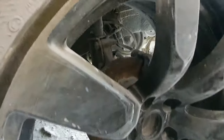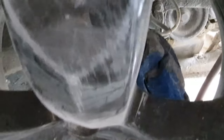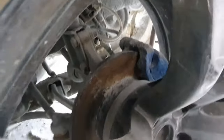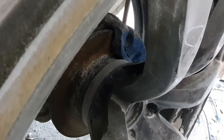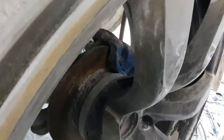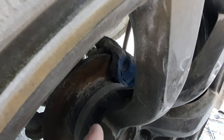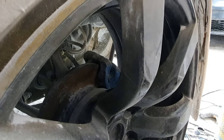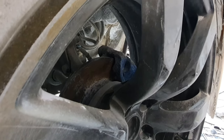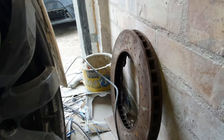So I've got the original 1.4 tiny little crappy brakes in there with the caliper. I'm going to have to do some work on that caliper to make sure the clearances are going to be fine for the new ones. Basically the disc is going to fit in that section and then hopefully clear the caliper - if not then I'm going to have to think of another plan. This is the disc that's going to be going on there, it just needs cleaning up.